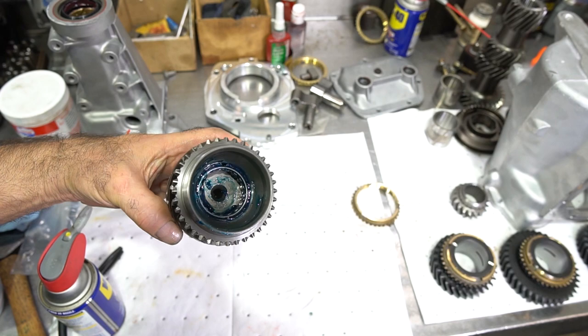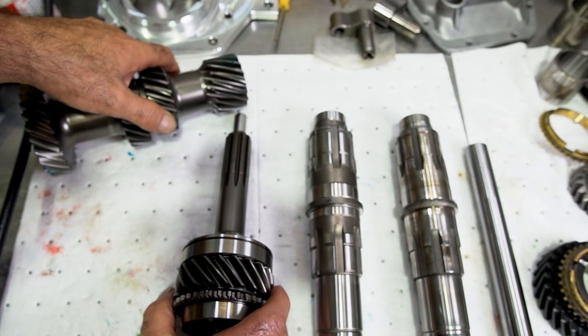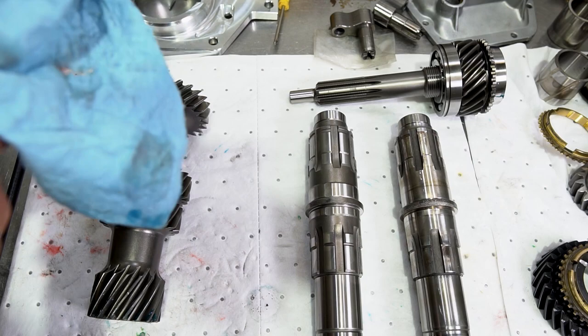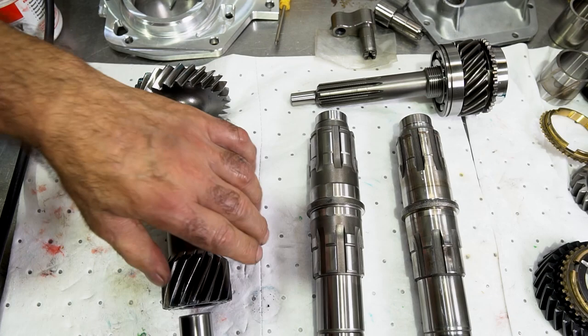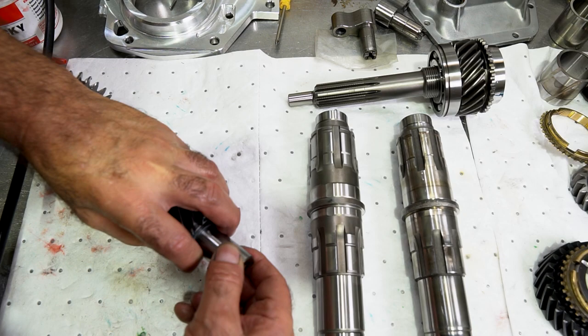To keep the needles in place, take some assembly lube and put it inside there. You can also individually put the needles in with grease in the cage if you're reusing the old cage — again I have a video showing how I do this. I've got my needle bearings packed in the counter gear all the way through, as well as in the main drive section. The reason I don't use dummy shafts — I've said dummy shafts are for dummies — is because I want to make sure everything feels good. I'll put the actual shaft in the gear and spin it to check it out and make sure it feels really smooth.